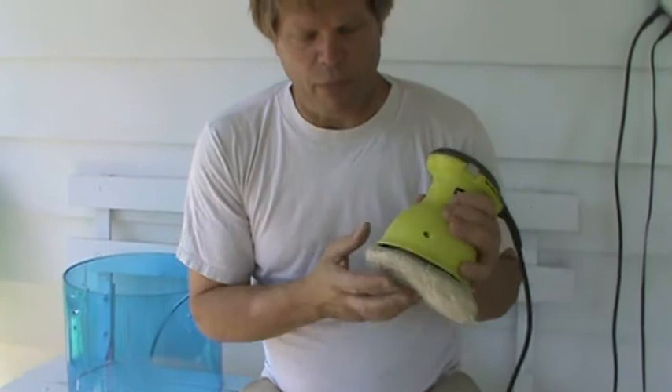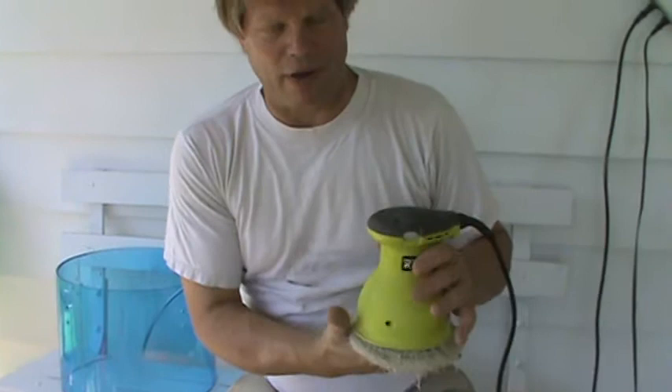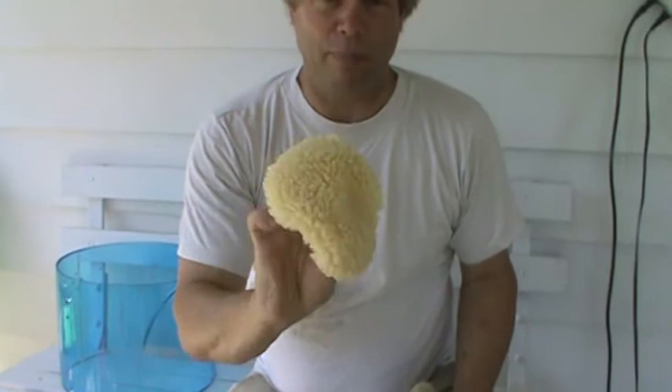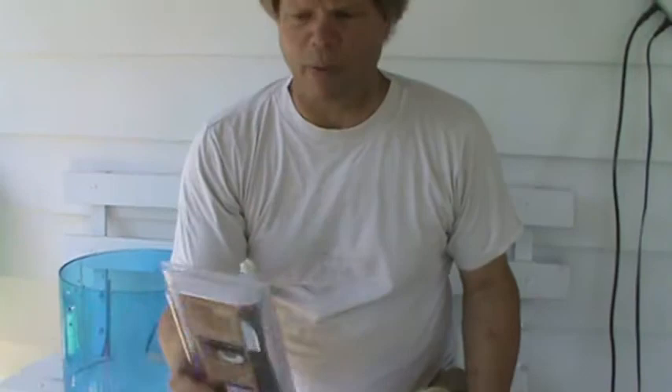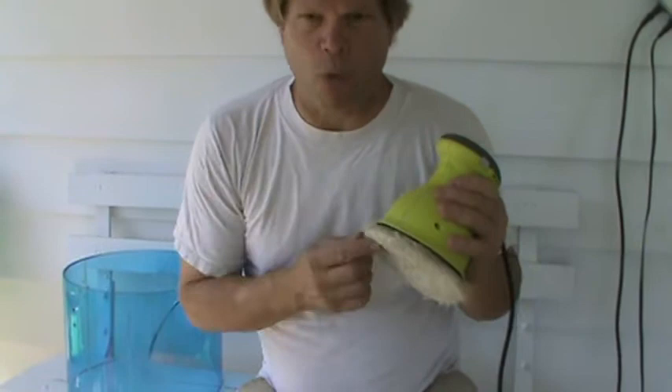It's a five-inch. When you buy a buffer like this, just make sure that they have plenty of replacement bonnets. You want to always use a fine, clean bonnet. Never set this thing down on anything — always set it on its side or have some kind of stand. Don't buy this from Home Depot because they do not support replacements — they sell seven-inch replacement bonnets for a five-inch buffer.